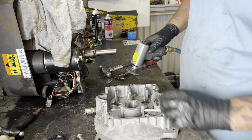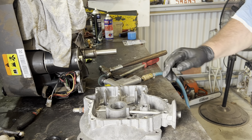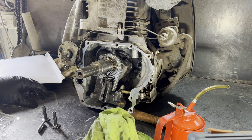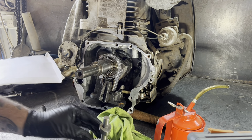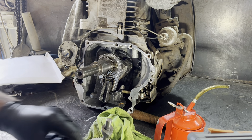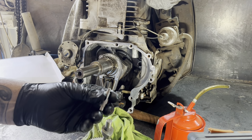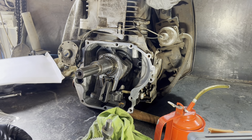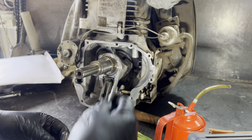That's pretty good, no ruts in that one. I'll just do the rest of that, throw the gasket on, we'll put him back together. What I didn't mention was also when you get those cams, you get a new set of lifters - inlet and exhaust, they're both the same - and you get a new pump shaft. If you remember I took the pump apart in the first video. I'll just put a little bit of grease on those, a bit of oil on them.